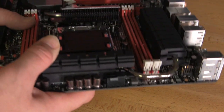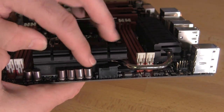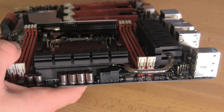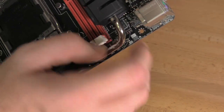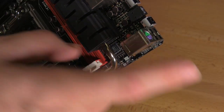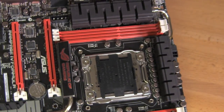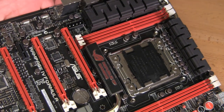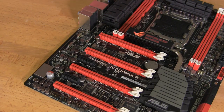Looking at the back, you can see the 8-pin auxiliary power connector is in a very awkward spot with some large capacitors nearby — it's going to be difficult. As always, we highly recommend picking up an extension cable and plugging that in before you throw it in your case. You also have another 4-pin fan header back here, a clear CMOS button in this area, and the cooling which is a little bit larger — oversized to keep everything cool and operating at its best efficiency. Moving down, there's a standard 4-pin Molex connector providing power to the PCIe area.